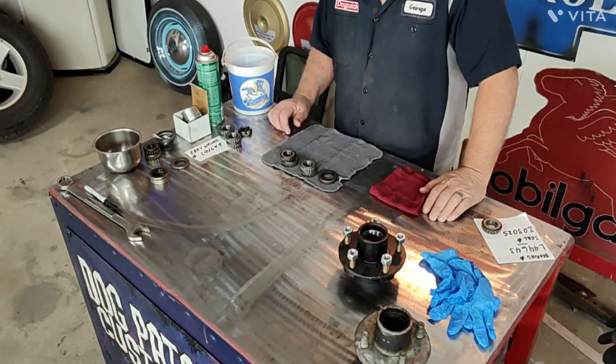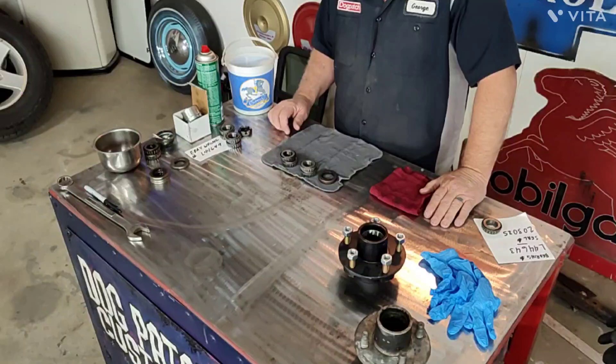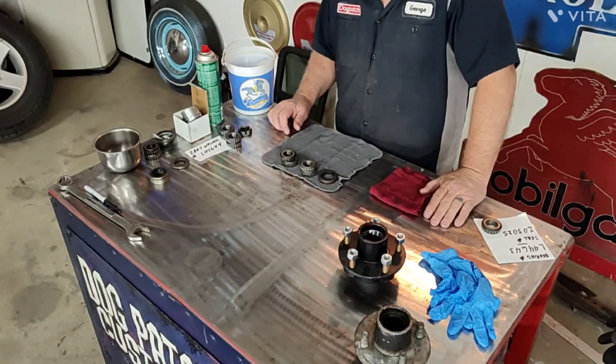Hey gang, welcome back to the channel. This episode we're going to do a little bit of maintenance and installation and customizing - do some bearing teardown, inspection, clean, re-grease them, check the seals, make sure they're alright, check the shaft, make sure it's clear and clean, no damage. Put her all back together. We're going over bearing part numbers and seal part numbers for the 2,000 pound axle. We're also going to look at some stuff available off eBay that is not quite right - I've seen a lot of campers come in with shafts torn up, axles torn up because of this. Then we'll put her back together, get the hubs on the square drop frame, and switch over to customizing a couple of old Jeep wheels.